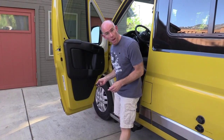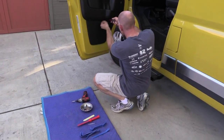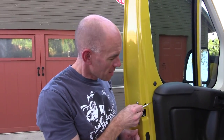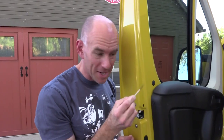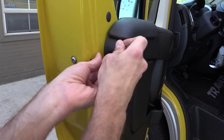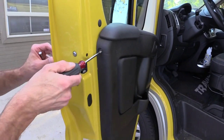There are some Phillips head screws under here — I'm going to remove those next. This next one's a bit tricky: there's actually a screw behind this little plastic plug. You're going to need something pretty tiny to pry that out — I have this tiny screwdriver. And it's just a Phillips head screw in there.